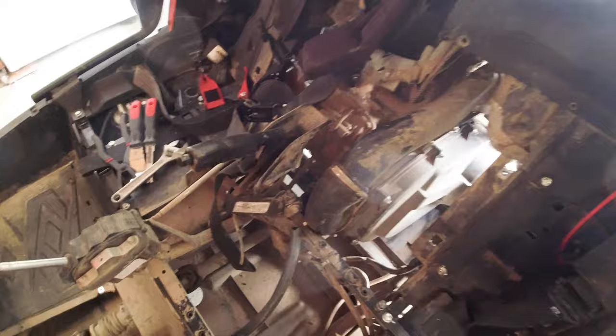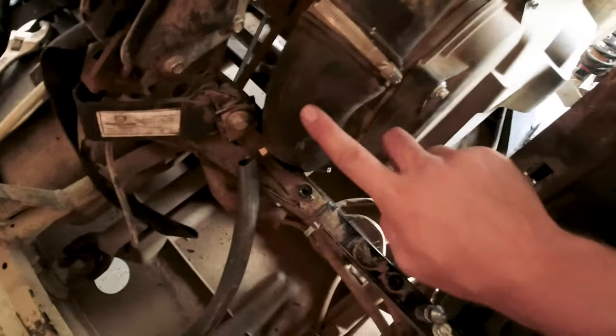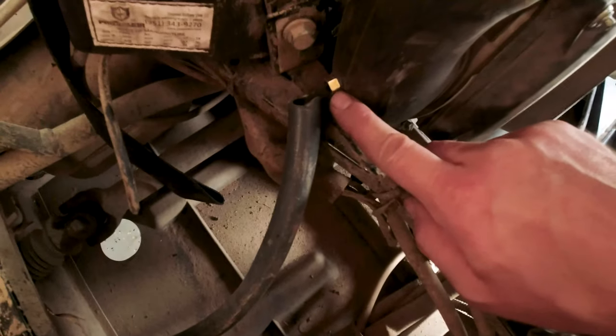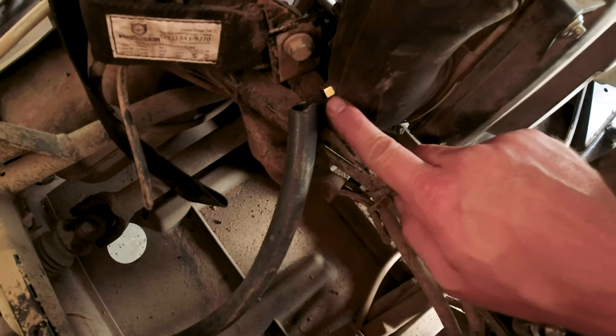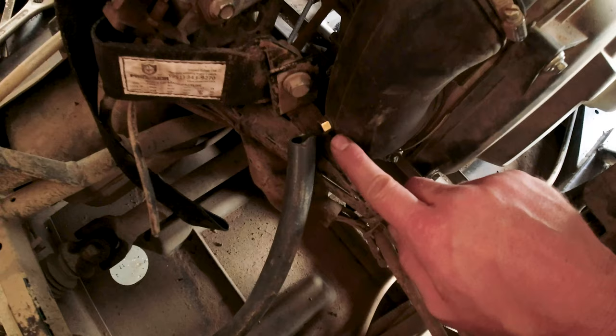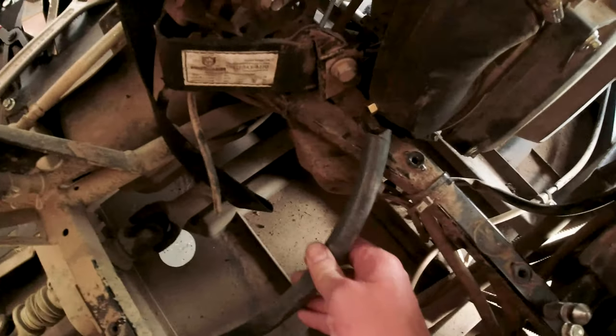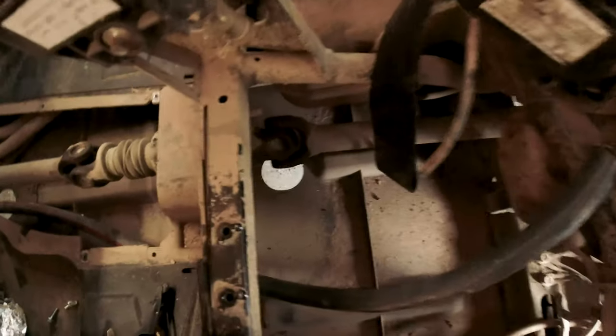So what I've got so far: you have to take apart all these plastics that are here. I took apart the center console plastics and went ahead and took this boot off right here. I installed the probe right here and I did use a nut on the other side and some Loctite and I got it all tight.